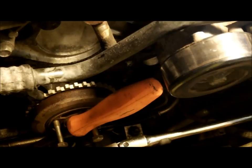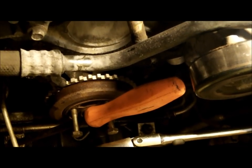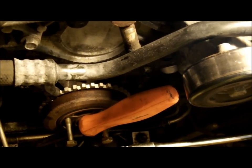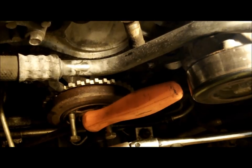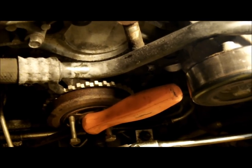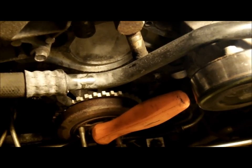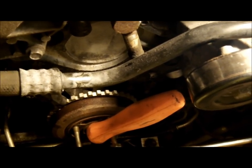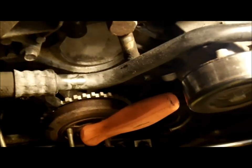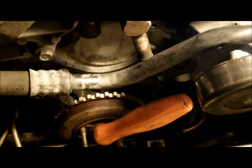The socket is the most important thing. Never use your engine hardware for tooling. Just get some bolts — it doesn't matter, bolts are cheap. Engine parts can be expensive. I'll come back when I get the pie shape puller — steering wheel puller, it has a million names — but they're reasonably cheap to buy anywhere. You don't have to have top of the line.